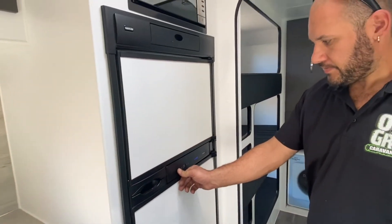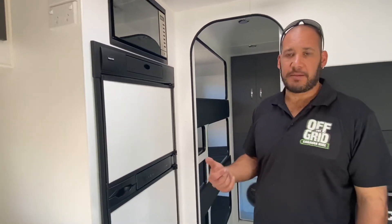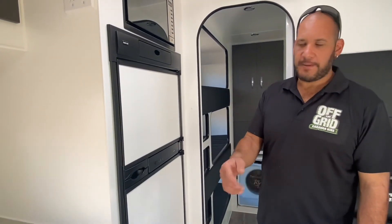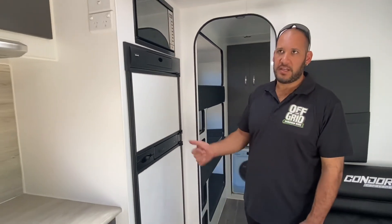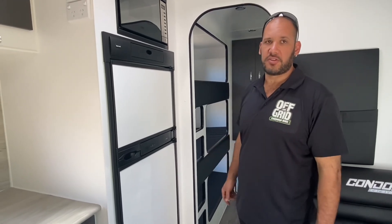Let me just turn that off now. If for some reason you have a problem and it doesn't pick up the gas — sometimes it does happen — it liquefies the gas in the gas line and you get airlocks. Just run the stove top first, then turn the fridge back on. Turn it off, wait 30 seconds to a minute, and turn it back on again. It'll reset itself and go through its cycle again to try and hook up.